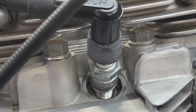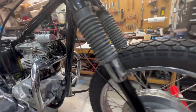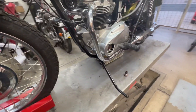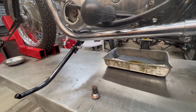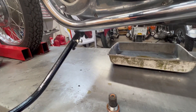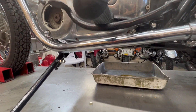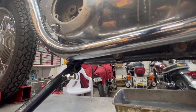In anticipation of putting the oil in, I pulled the sump plug out to make sure there was no dead oil in the engine. There wasn't — maybe just half an ounce or so. Normally when a bike has been running, there's about four to six ounces of oil in the sump at any one time. This only had a little bit in there, meaning the bike probably hadn't been run since it was rebuilt.